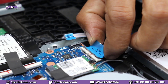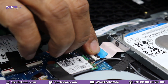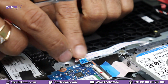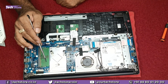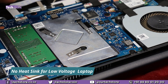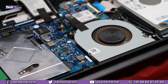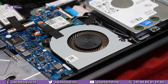We did a design correction here: instead of the cable going over the hard drive, we routed it below the hard drive, then put the screws back and reconnected the connector. Note that Extensa models with Core i3 or Core i5 will have a much bigger heat sink connected to the fan. For this low-power processor there is no heat sink as such. If you want to replace the fan, just remove the one or two screws and the fan connector and you can swap it out.